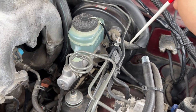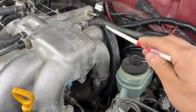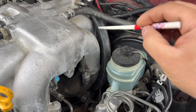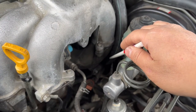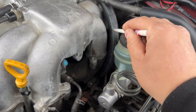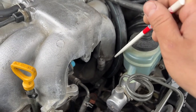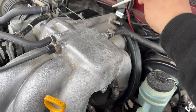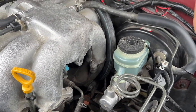This is your brake booster line — it goes from the brake booster into the plenum, so make sure you have this. This big hose here is the heater core hose inlet. What I did is a bypass — I went straight from the bottom of the cylinder head. Coolant comes out from the cylinder head and goes right into the heater core. If you don't have this bypass, what you have is the pesky heater hose — a two-inch hose that comes out from the cylinder head, goes into a metal tube, and the metal tube connects into another hose that goes in there. I did the bypass because it's simpler for me. Don't do it unless you understand how it works.